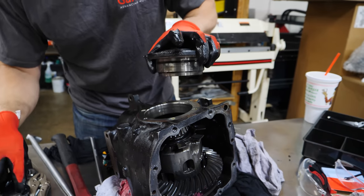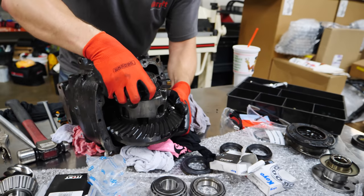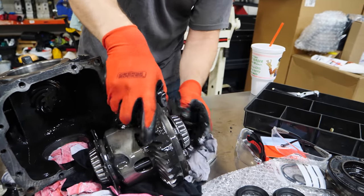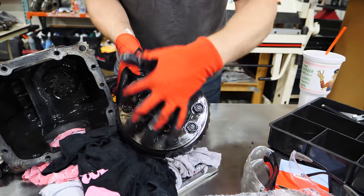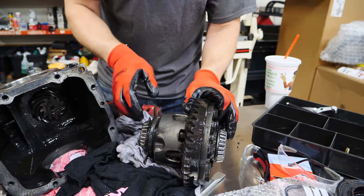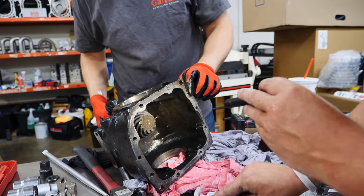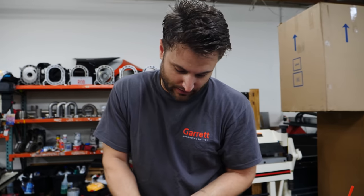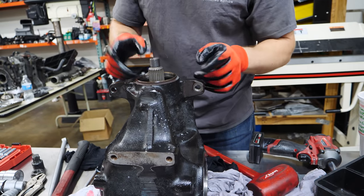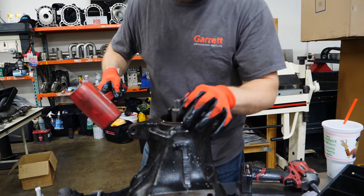This is this side, this one is the other side. This really comes out relatively easy — there we go, it's a baby limited slip. That got a lot lighter. Replacing the ring is so much easier than you think because all you have to do is unbolt and re-bolt these bolts when we're done. Sadly, it then changes where all the bearings are — and of course we're going to do the bearings anyway, so all of that changes. So it's funny because upgrading or changing ring and pinions is so simple, but yet not at all.